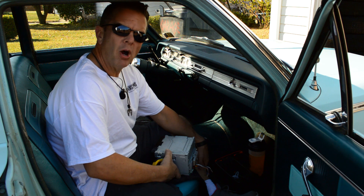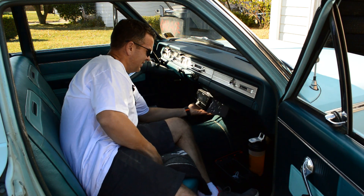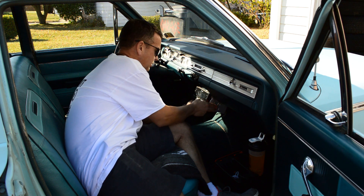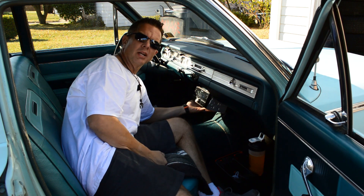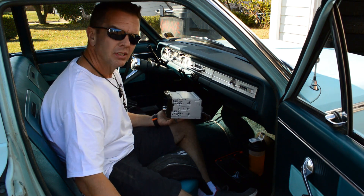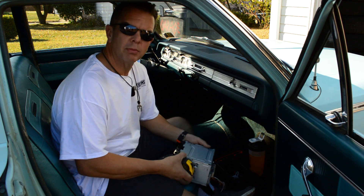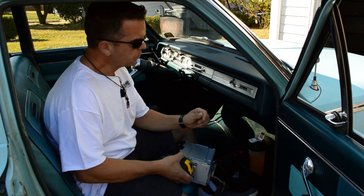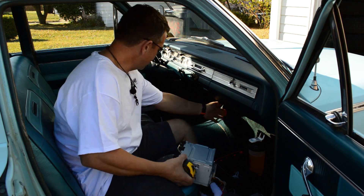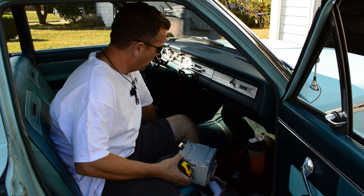What I'm going to do is get started with the mock-up. I'm going to use three-quarter-inch MDF. It's going to sit kind of like this, and I'll mount it at the bottom after the console is all constructed. I'll do a little side panel test fit, and since it's actually identical on the other side, that's going to make cutting the side panel a real easy job. Let's get started.